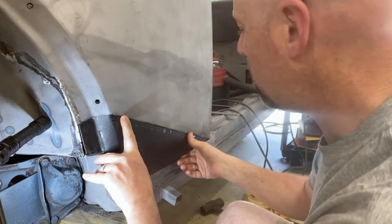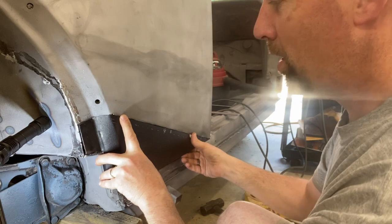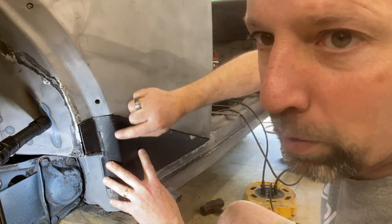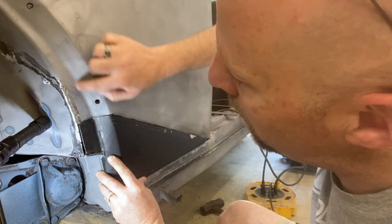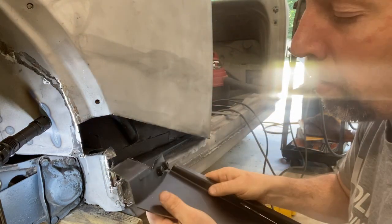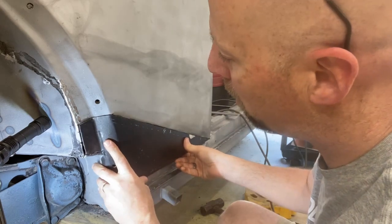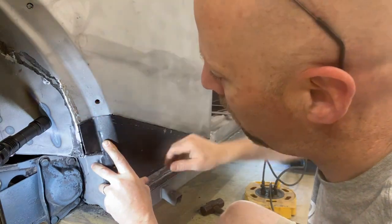It's another day. We're back at it on Saturday. Hope by the end of this day is to have this at least tack welded in — Dale gets mad at me when I jinx myself and set goals. Overall, we're looking pretty good from this corner up to here, and this is where we start running into troubles with aftermarket pieces. If we match this radius here, which is visible on the exterior of the car, that's a really critical one. This internal valley here did not line up with this groove here — the flat here was narrower than this one here. So what we ended up doing was bending this piece flat and then re-bending this groove in a different spot. The fender bolts in here, so really you're only going to see this if you stick your head inside the fender, but we still want to get it as right as we can.